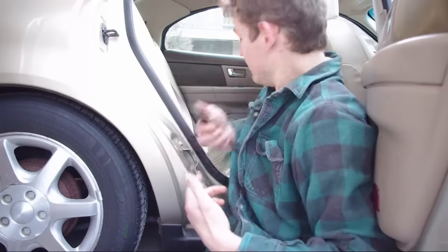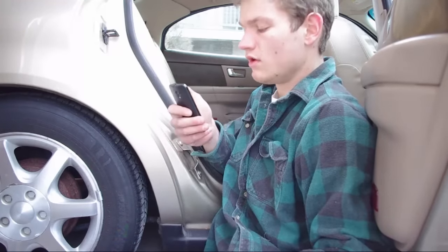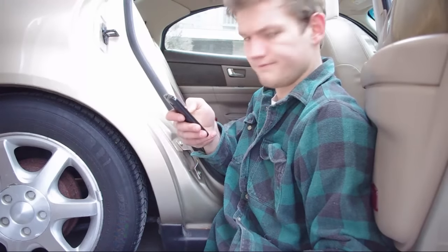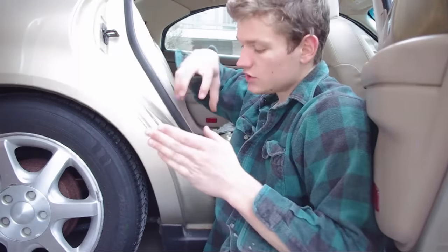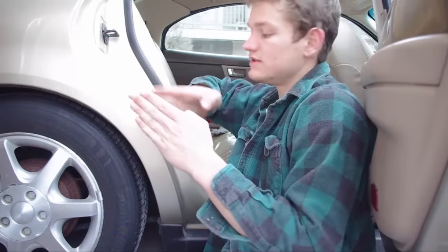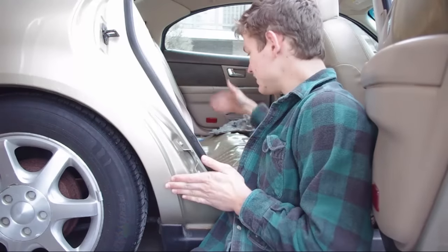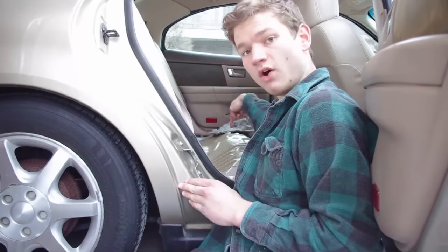Now you need to know where to cut. Pull out your phone or computer and Google image search a gas tank for this car — 2001 Mercury Sable fuel tank. Look at a picture of the replacement and figure out where the top opening is where the fuel pump will be. In this case it's about two thirds over on the tank, so you measure from the back seat to that spot on the tank and then start planning where to cut the hole.